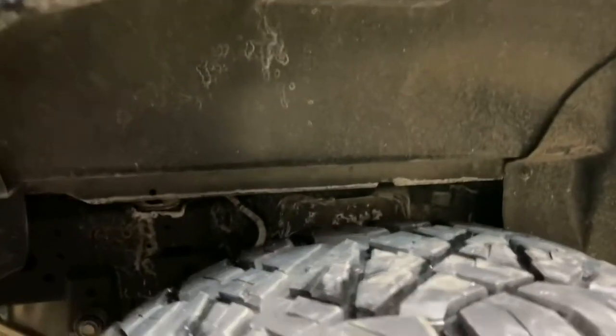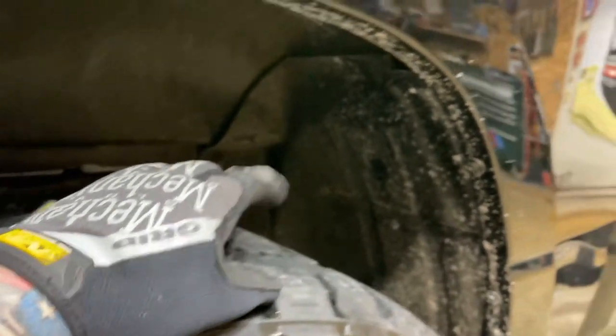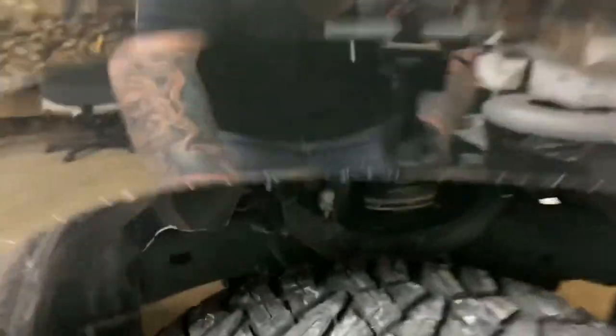Look at that reflection - she's pretty dirty. So the back part, you got a portion of a wheel well liner up front and a portion of a wheel well liner in the back. That's just all metal. What I'm going to do is pull this forward liner out and mount that rock light just about as high as we can up there. That should shine enough light back to light up the whole wheel well. In the front we'll do the same, and that should give us enough wiring that I don't need to cut, extend, or get any extensions.